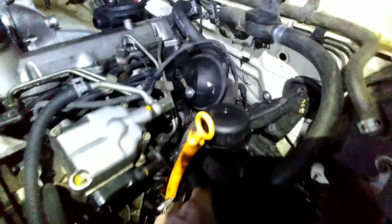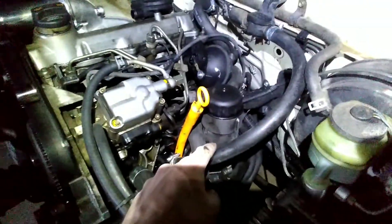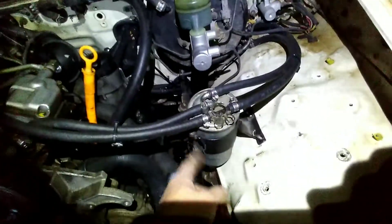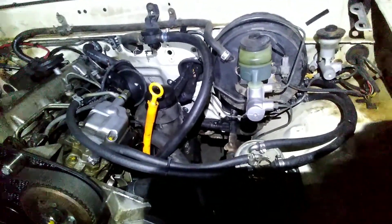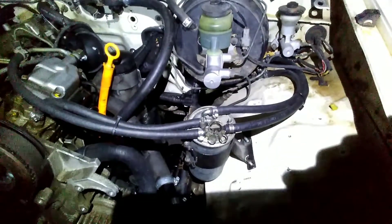This is actually the factory Volkswagen lower hose and it goes right, curls around the oil filter housing and goes right in there to the back. Just ran the heater core lines here and looped that one around to the back port over there. I've got the fuel lines just running over here to the factory filter. I did put an H in the line there and I'm just running the factory Toyota fuel pump for now — we'll see how that works, but so far it's working well.